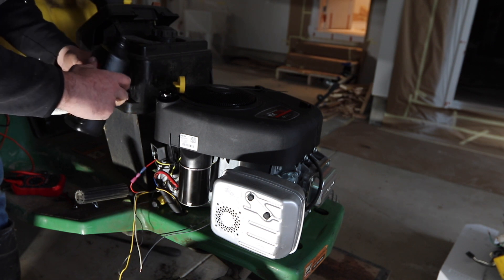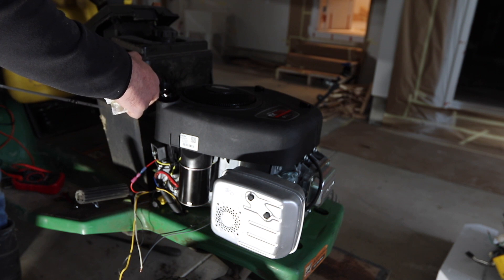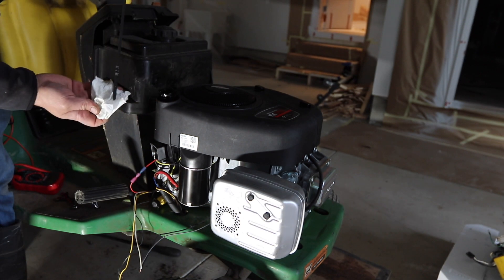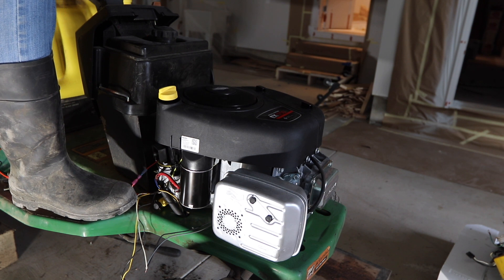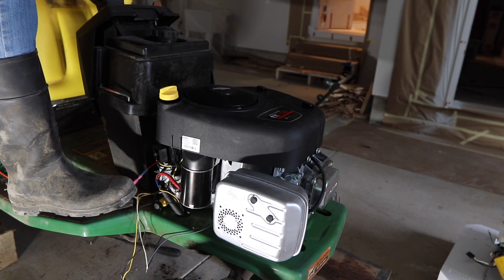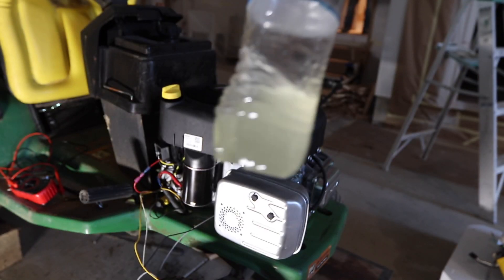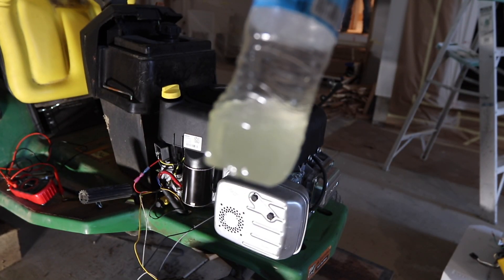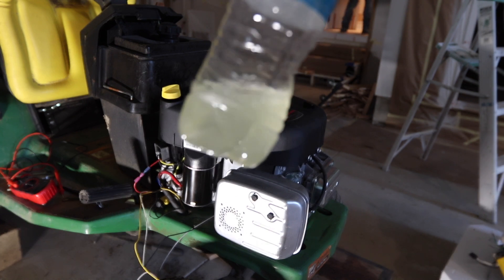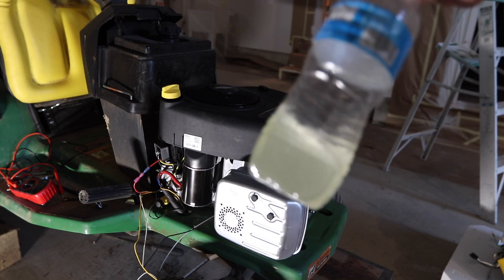These take about 40 ounces, as the book says. It's 5W-30 in case you're wondering. Fuel looked like lemonade — obviously a fuel contamination issue and that's probably why it's not firing. So I'll go get some fresh gas.